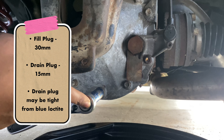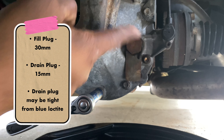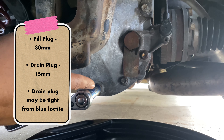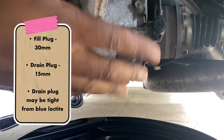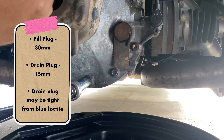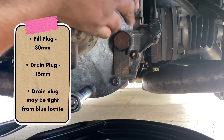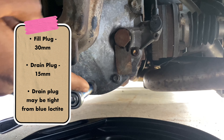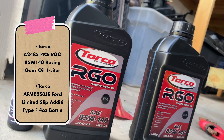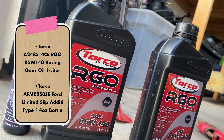You're going to want to take the fill plug out, or at least loosen it, prior to taking the drain plug out. That way you know you'll be able to fill it back up. Because if you drain it first and then the fill plug is cross-threaded or stuck, you have a whole situation - you can't put the fluid back in and you'd probably have to take the whole cover off. Always check that the fill plug will come out first, like mine did, then deal with the drain.